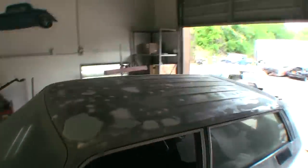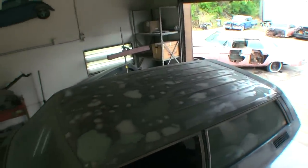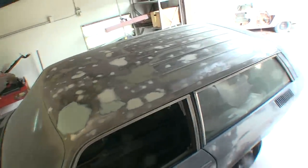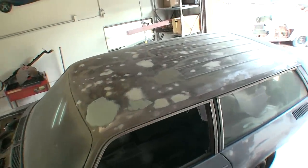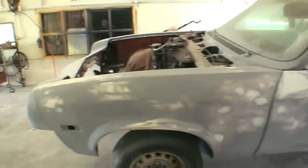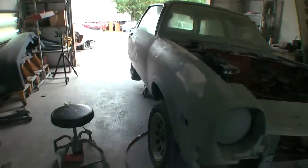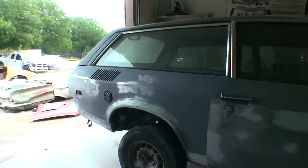We did a lot of work on the top of this car — there was super heavy surface rust that had to be removed. What you're looking at now are the stains from the vinegar water treatment I used on it — that's another lesson. After cleaning all the metal and properly preparing it, I put epoxy primer on it. The problem is you still have to do bodywork to the vehicle, because this is only a sealer to protect the vehicle while we're working on it.